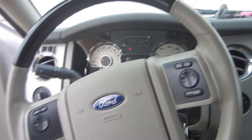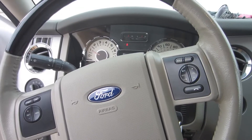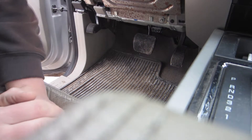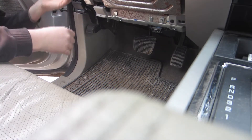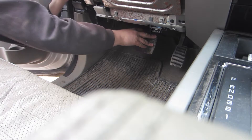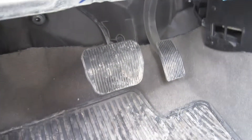The second thing I'm going to show you is how to change it so that it doesn't run for 10 minutes but actually runs for 15 minutes. Press that little programming button and hold it along with the brake pedal at the same time until you hear the horn honk three times. Then press the override button twice. After that, press the brake pedal three times.